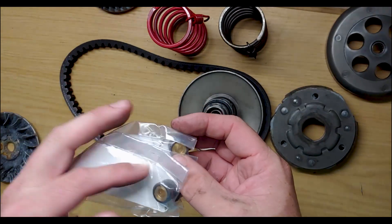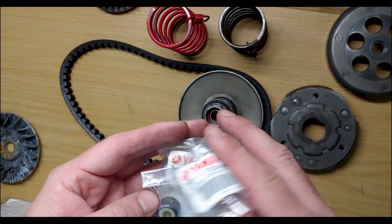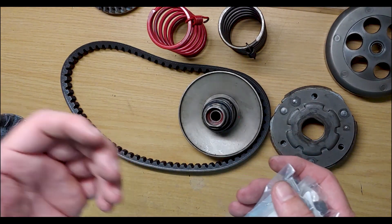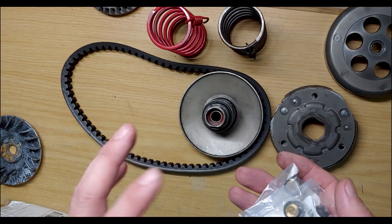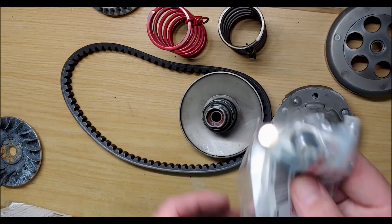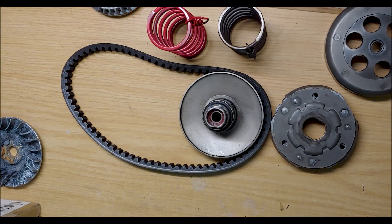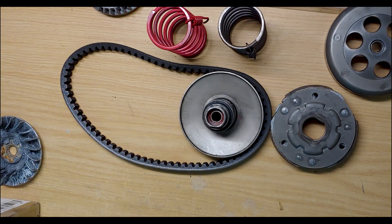If you're struggling to find rollers, Yamaha does keep stock. These off a Yamaha Nitro 100 are fairly heavy at 12 grams. Bwiz rollers are around eight or nine grams. A Yamaha Jog 90 and Jog 50 are six and four grams respectively. Between those four bikes you should be able to get a setup that works for you. These are 15 by 12 millimeter rollers. You can also import them, though Yamaha can be expensive, and getting shipping from overseas can prove tricky.